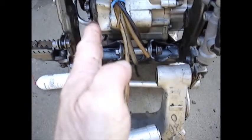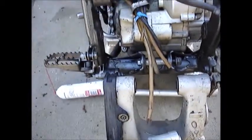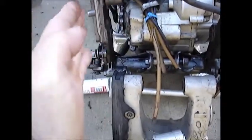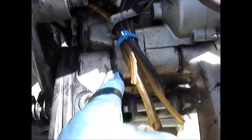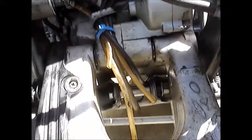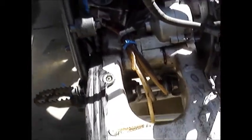So that's why the swing arm would go back and forth like that. That would explain the chipping of the sprocket. The swing arm's like this, if you will, and it starts pulling that chain against the side of the sprocket and chips the tooth. Alright, so now we don't have any funny gaps. Right? Everything is right. I'm trying to flex the swing arm. Of course you can't see that.